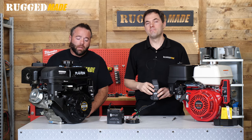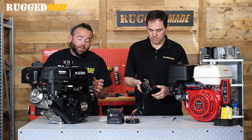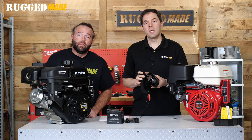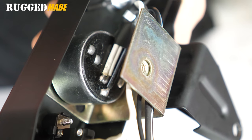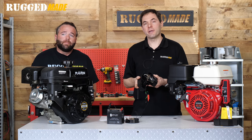Start by inspecting the starter panel box, cleaning the ground, and inspecting all the solder joints to make sure everything is connected. Sometimes you might find bug nests in there, or from a long life of vibration these little solder joints can fail. Corrosion can creep in, so it's a good opportunity to check the health of your wiring.